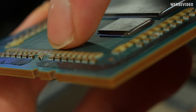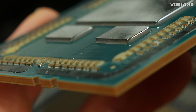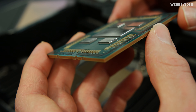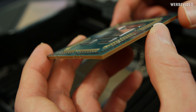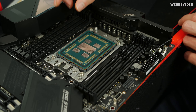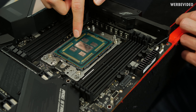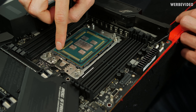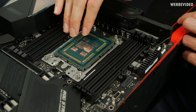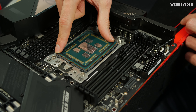If you look at the areas next to the chips, it looks like those areas were prepared for additional chips in future — the base design of this CPU is likely the same as the 64-core, so you can see prepared solder pads underneath. For the first test we will just use conventional thermal paste, quickly putting the CPU inside the socket. The concern is that with the water cooler on we'll only have pressure in the center, and it's very likely the contact on the corners won't be enough — potentially the bad contact means the system won't power on. We'll use conventional thermal paste first and just see if it powers on.